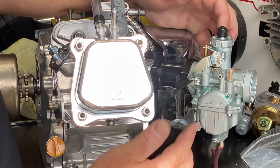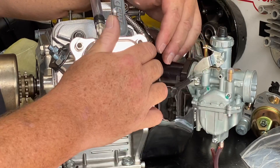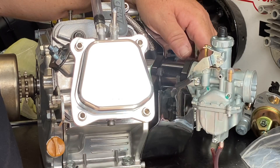Don't try and tune your carburetor with the choke lever up. If you have a vacuum leak, yeah, the choke lever up is how you're going to have to run, but fix your vacuum leak before you start working on the choke lever.